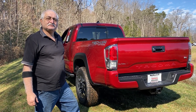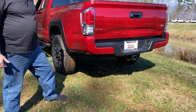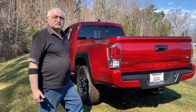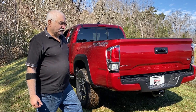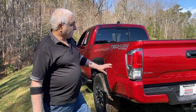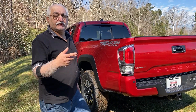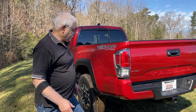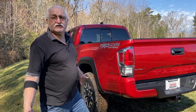Ali, I think this might be a great day to talk about locking rear diff and traction control — we've got really muddy terrain here, it's really slick, it was fun getting out here. Can you explain how those work in a scenario like this? Sure. On a normal vehicle, the driven wheels on the slipperiest side of the road will get most of the power going to them, while the wheel with the most traction doesn't get very much. This causes the vehicle to get stuck.